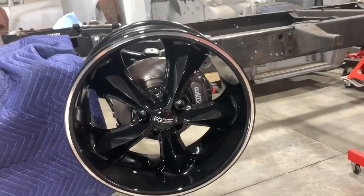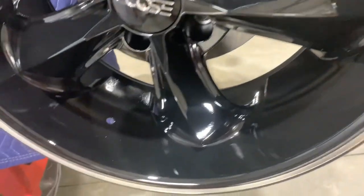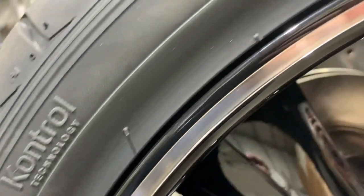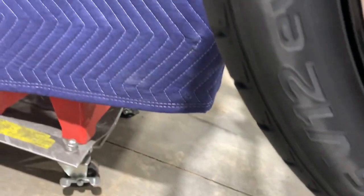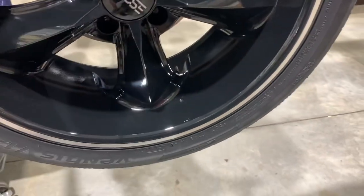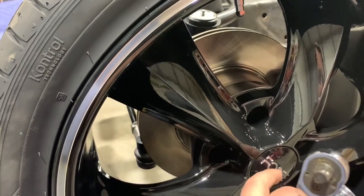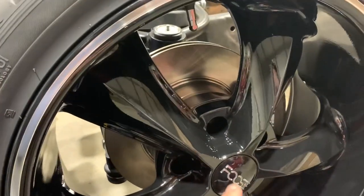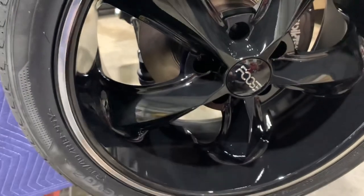Wow, I don't know about you — oh my goodness, is that beautiful or what? I'm in love. We just got back from the tire shop and had our tires mounted on our rims — they are looking super nice. This is the Hankook Ventus V12 Evo 2 in a 235-40-18. They are rotational, so they have to get mounted in opposite positions. You can see the little arrow showing the rotation for the driver's side. The good news is that the rotor snout does in fact have plenty of room before it hits this cap. I don't have the dust caps on the rotors yet, but I measured and I have plenty of room. I'm going ahead and tightening down the lug nuts — they're a special key form.